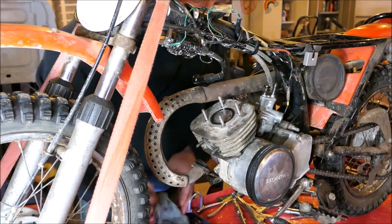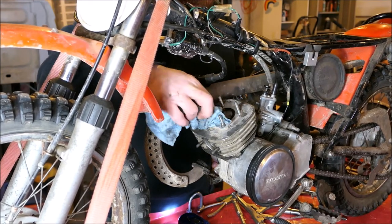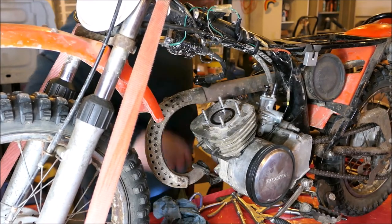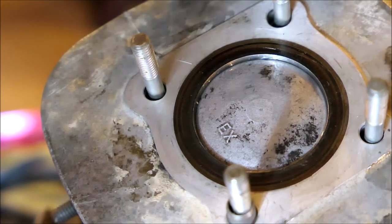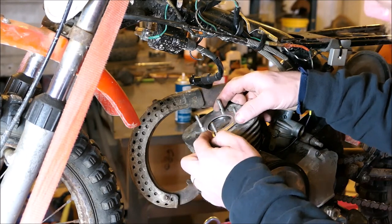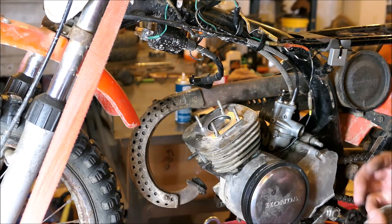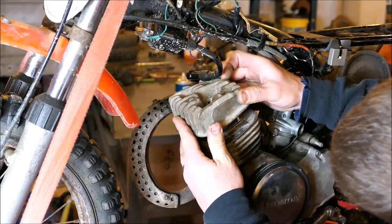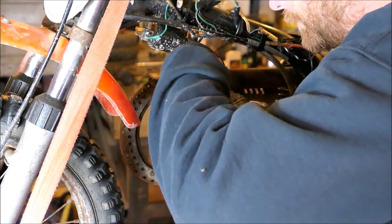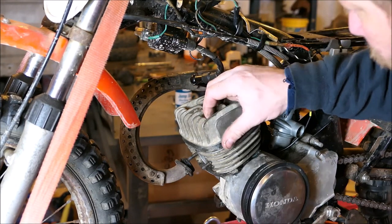Very nice — that pleases the Benny. This piston is marked EX on the top for exhaust, so you know the piston points towards the exhaust side. Our head gasket goes on one specific way — make sure your dowels are in there too. Two dowel pins. Cylinder nice and cleaned up. There are only four washers and bolts on this little puppy.